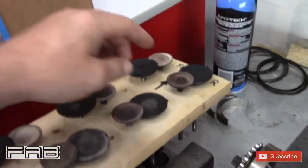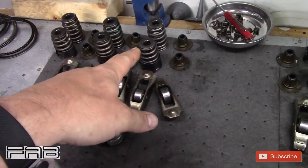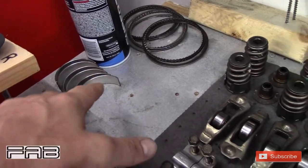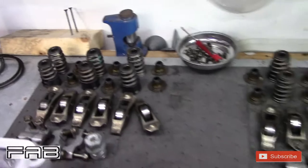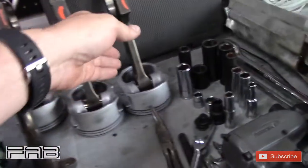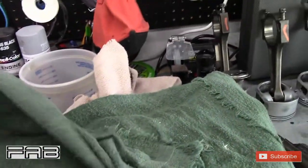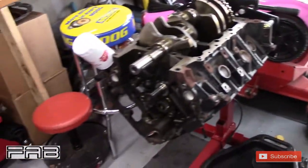Here's one head and here's the other - pretty much as clean as it's going to get. Here are all the valves. I found that the intake valve on the right bank was bent, but the head and valve guides are good. You've also got the camshafts, rockers, valve springs, and valve seals. Here are the lifters I took out of the engine, and three of the pistons already cleaned in the blast cabinet - they look almost brand new.